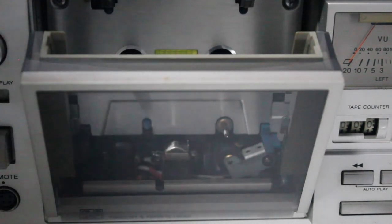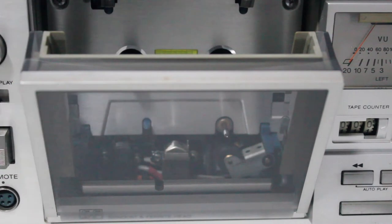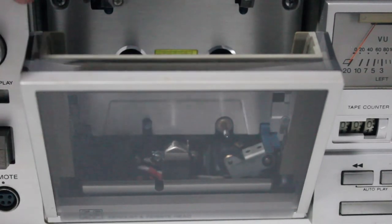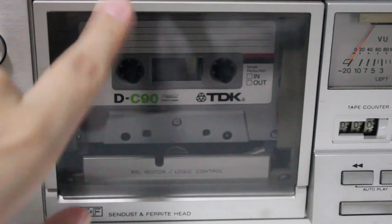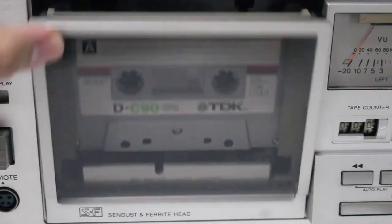And then you could see the head just go up there in the pinch roller. And it's much easier to spot a dirty pinch roller or a pinch roller that chewed a tape. Speaking of, the seller also cleaned the entire tape transport, and I can see that very clearly. Very, very clean area. And very, very beautiful deck. For pretty cheap as well.